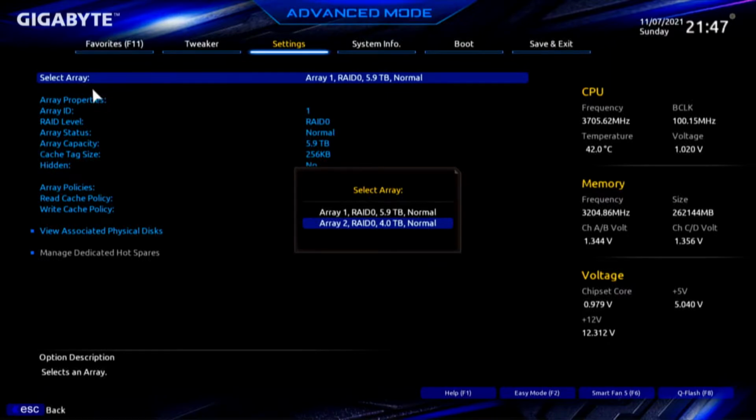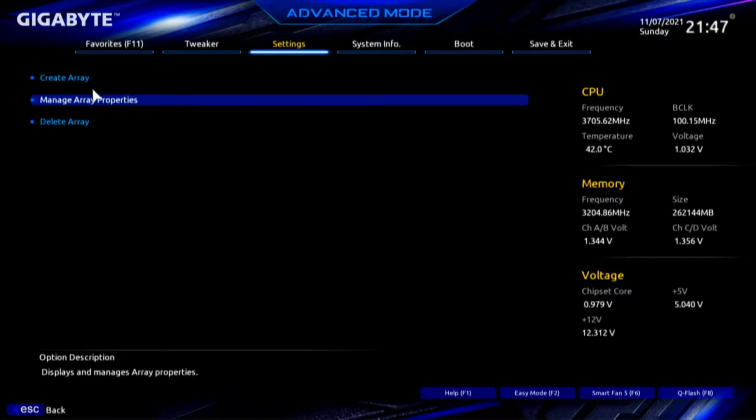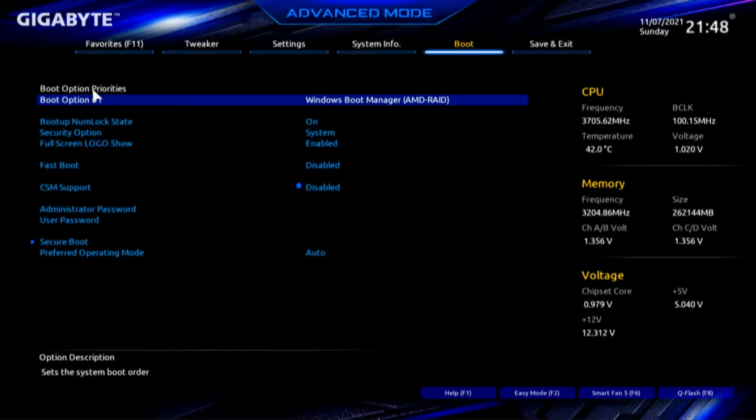It's meant for clarity and not to confuse. Okay, we're good to go. All we have to do is escape out of all those menus, and we're set for a boot. Theoretically, we could do another install of another operating system on that other RAID and have a dual boot. But as always, any dual boot should be completely separate disks. This is all the same bunch of disks on one card, so keep that in mind.